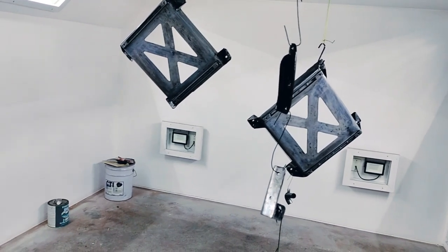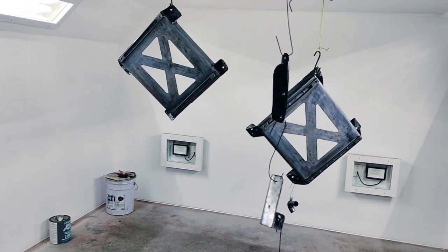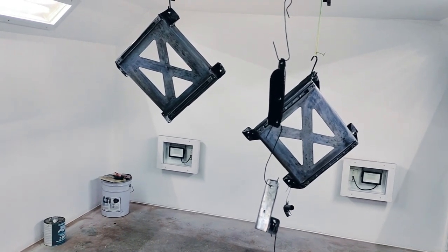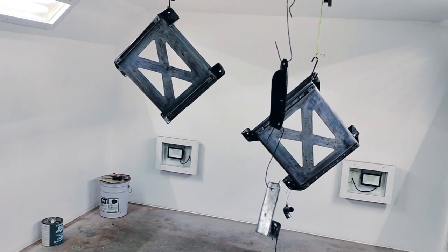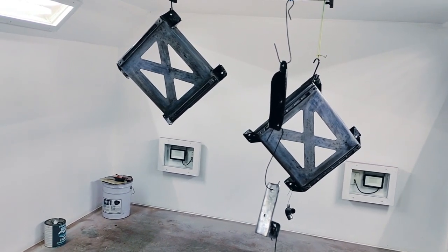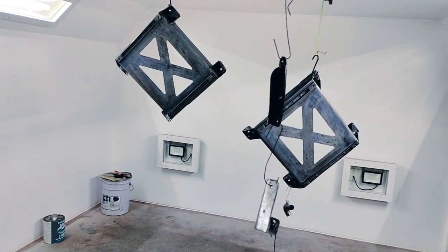If you were doing the car bodywork, then obviously there's a bit more prep involved with that. You'd want to epoxy and then do all your prep work, like all your body filler and all the rest of it. And then I tend to epoxy straight over the top of that filler again to seal it. And then I put a high build over the top of that.